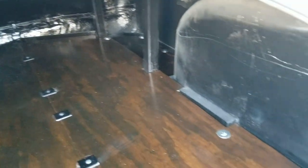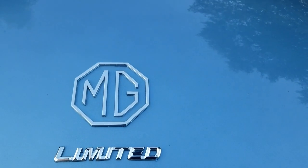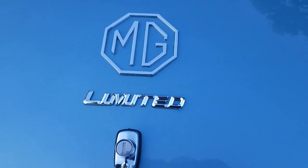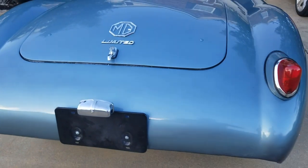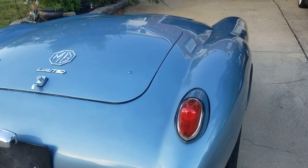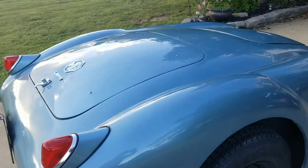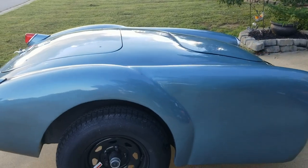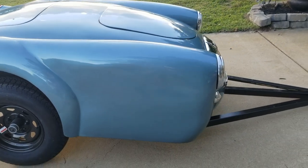The frame has been coated with SummitRacing.com's chassis paint, which, frankly, is probably the best paint I've ever used. Prior to doing any body work, I spray the unfinished product with multiple coats of epoxy primer. Over this, I lay down fiberglass to fill the voids and imperfections, and all this means that in the event that the paint gets nicked or suffers gravel hits, the epoxy primer coat won't allow water or moisture to hit the bare metal. The paint is Elkhart Blue.